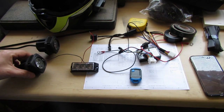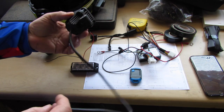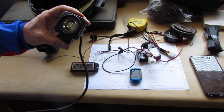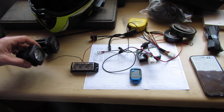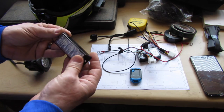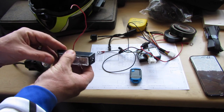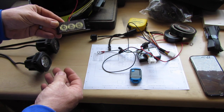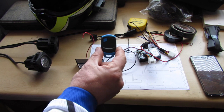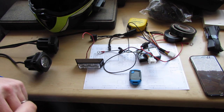What we'll be installing are these 10-watt LED spotlights — generic 12-volt, 10-watt LEDs at about 900 lumens or so. Pretty bright enough for other vehicles to see you. We've also got a brake light here, which is an LED-based one with three LEDs inside. Burns nice bright red and that'll be added to the back as an additional brake light. I'll also be adding a remote onto that so I can use the motorcycle's standard controls to open and close my gate.